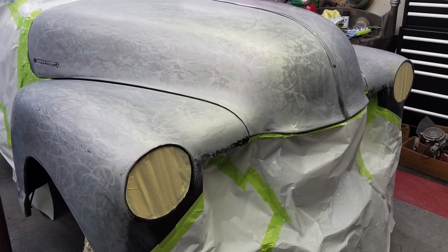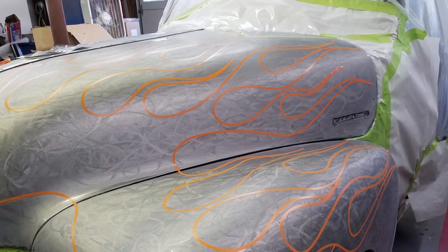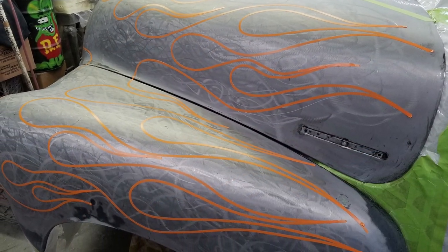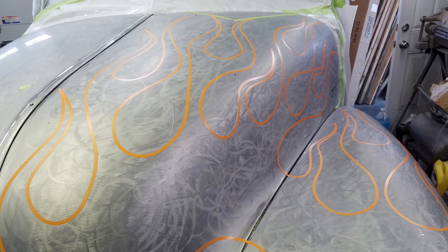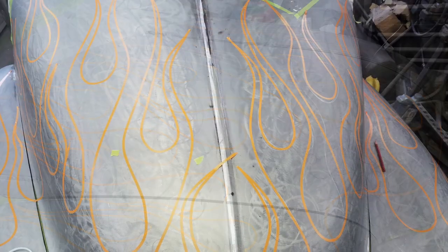I drew up a few patterns that I wanted to use, until I got what I thought was the perfect flame pattern for this truck. I used a new tape I found — FBS, I think is the name of it — quarter-inch fine line tape, and the tape was fantastic. No matter how many times I laid it down and pulled it up, it still stuck like it was brand new. If you've ever done flames, you know you're never happy with the pattern you pick. You keep going over it and over it to try and get the best look. I finally got it to where I was very happy with it, and all the licks were done.